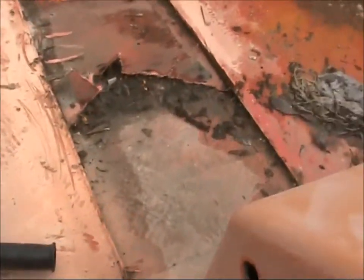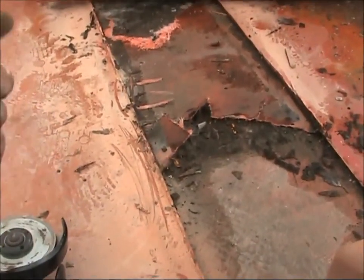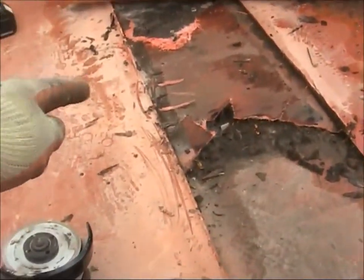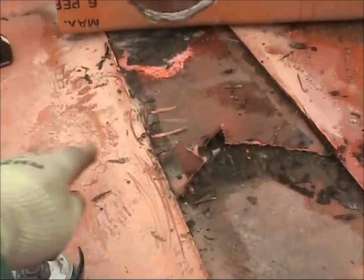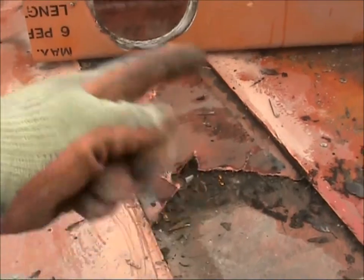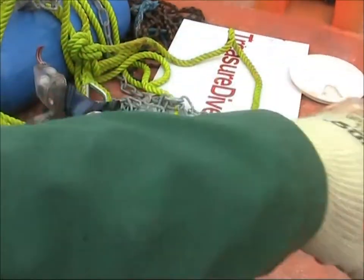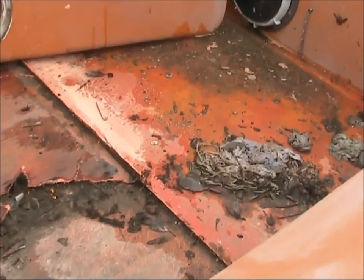Once I've tidied up this floor - they obviously laminated up the sides of these seats so there are thick ridges down both sides - all that's got to be ground out. Then I'll probably have to patch it with some fiberglass, put a couple of 450 mat patches over it, sand the whole lot down, and then repaint the whole deck with a nice anti-slip paint. That's the idea anyway.